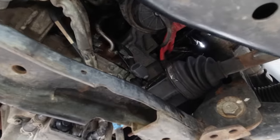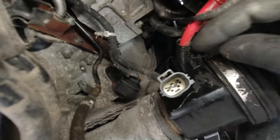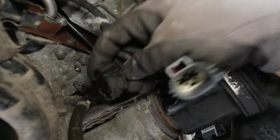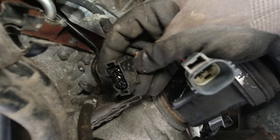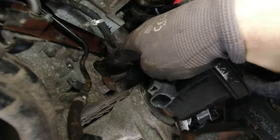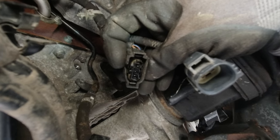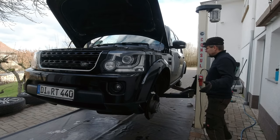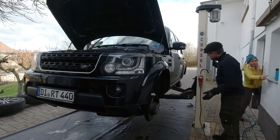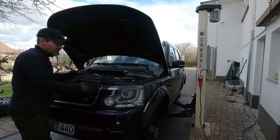I got the starter motor out — took me about 35 minutes. But I did see one thing: I inspected the oil level sensor plug and you can see there's oil inside. This thing is leaking through the connector and the oil is going to pull through the wiring harness — that needs to be fixed. I don't have a part to fix that today. I got the wheels already removed, which I need to do anyway so I can lower it further down.